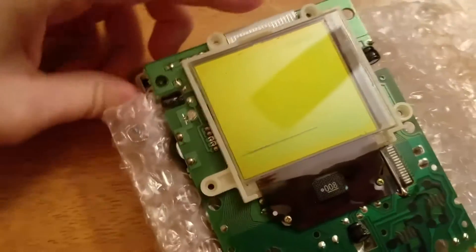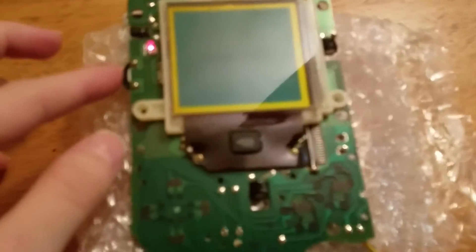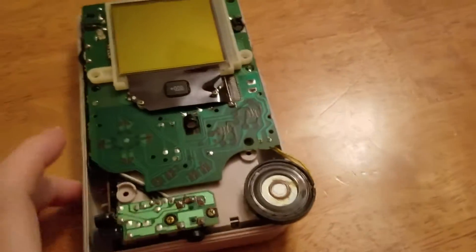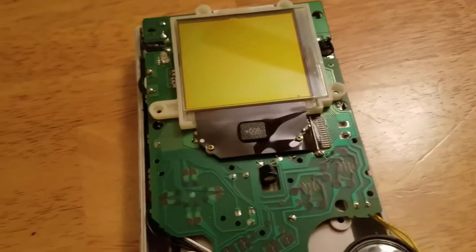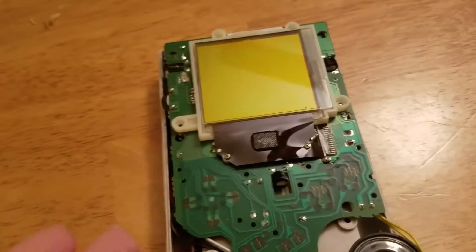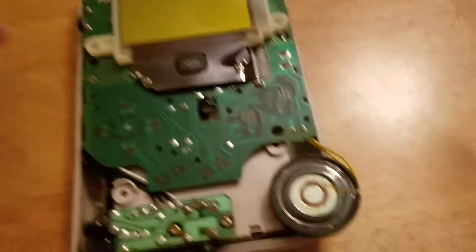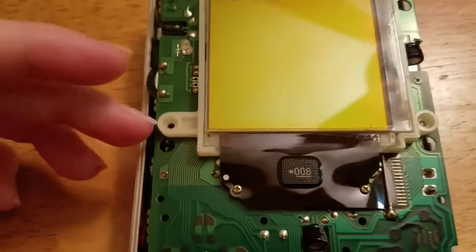Here's the final update — I finally got it the way I wanted it. We'll turn it off for a sec and turn it back on, and it still gives me the full black screen that I need. Now if you don't need to clean your system, you can just reassemble this by putting the ten screws back together and reattaching the ribbon cable, then putting the six tri-wing or Phillips head screws back into the back. If you had to take off the adhesive, put on some electrical tape down there so it sticks — it acts like a little cushion for the screen.